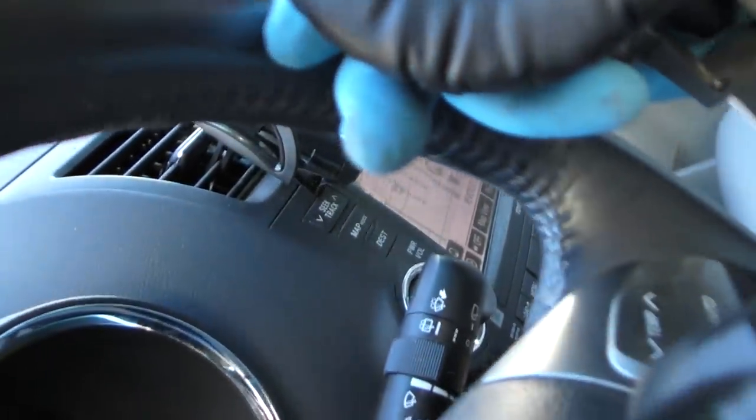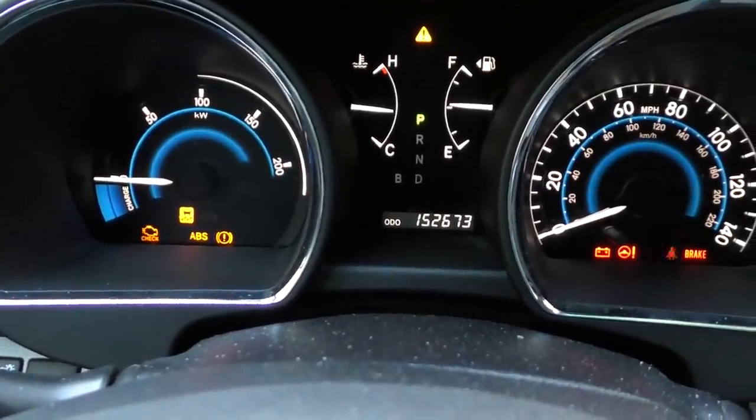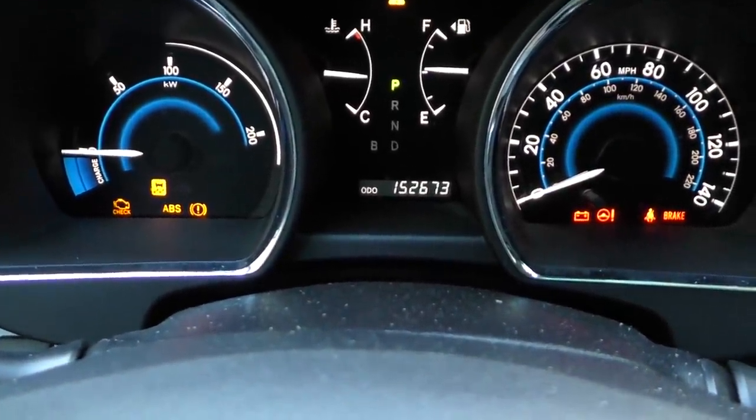Lo and behold, I can hear it whining a lot louder when it's on number three. I'll switch it to number four, and number four is whining even louder - listen to this, you can hear it whining now. So thanks to the Steelman chassis ears, we've pinpointed the sound. We didn't guess that it was an axle bearing - those things are $330 a set. We would have replaced those if we guessed and it wouldn't have fixed anything. It's in the differential. This Highlander has 152,000 miles on it, so we know the differential is worn.